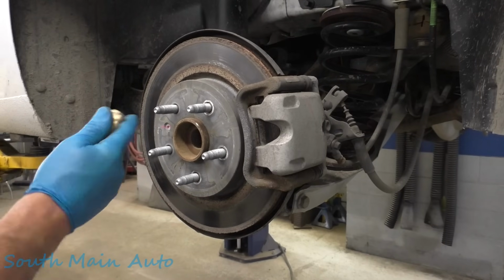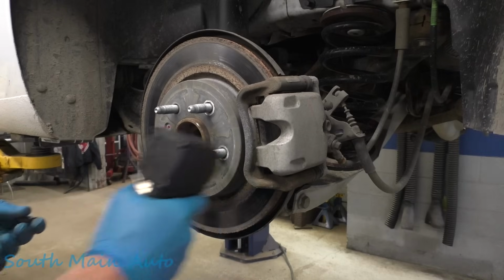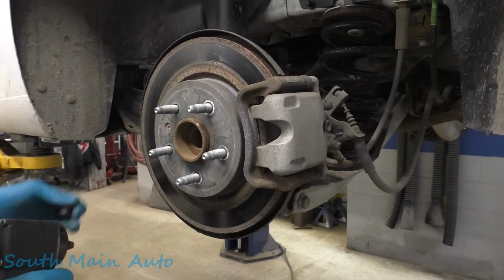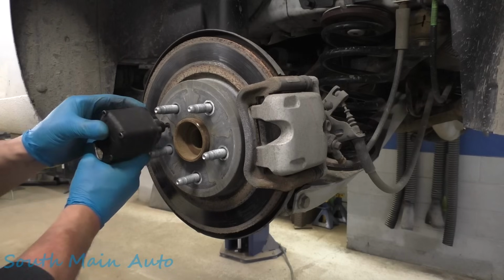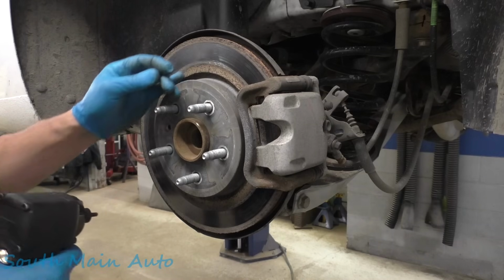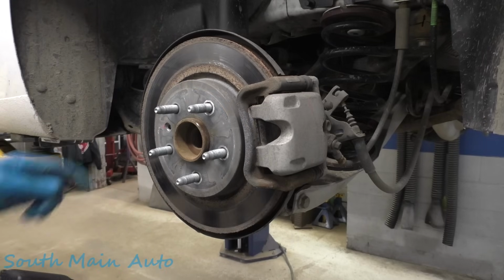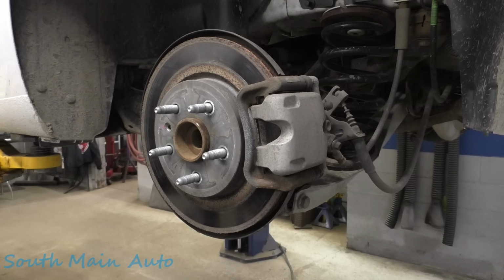So this lady's been having a bit of a spell with this, we'll call it. This Buick here, this rear caliper keeps locking up on it. As you can see by the white toasty marks, this brake gets really hot. Or maybe that just looks like regular rusty. Regular rusty is usually orangish, but when they get hot, usually the edge of the pads will get all ashy. They'll turn kind of this whitish color. White-ish, I said, not actually white, but you know what I mean.